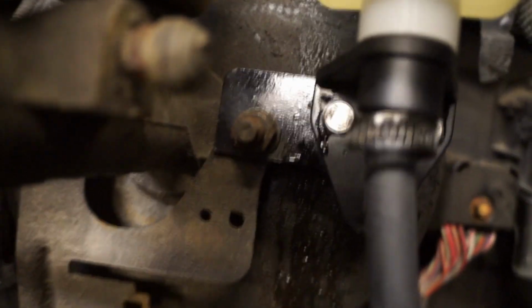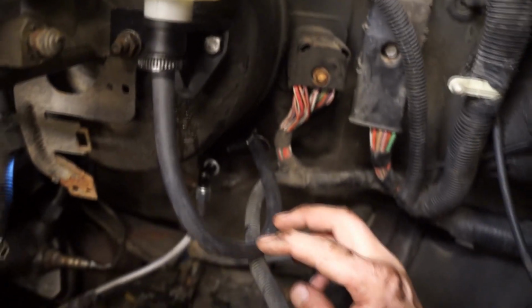So the master cylinder reservoir has been mounted here with that little bracket that is provided with the kit. It goes directly on the stud here that holds the car master cylinder. Simple procedure here. That hose is like twice the length, so just cut as you need.